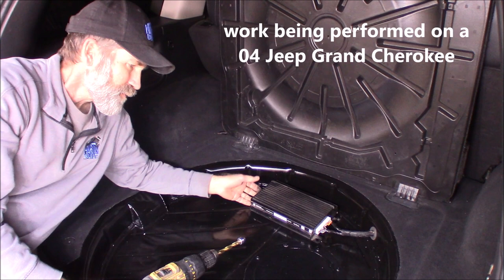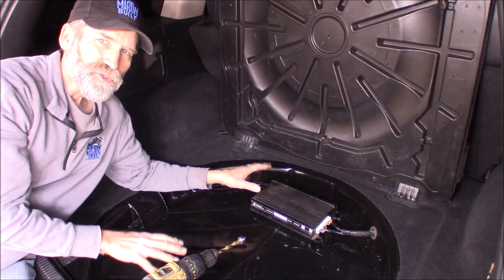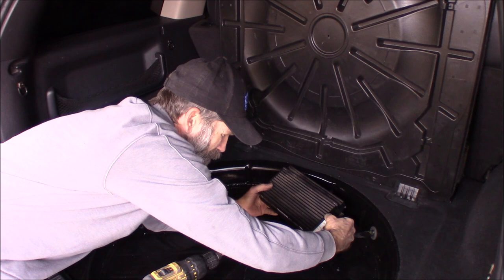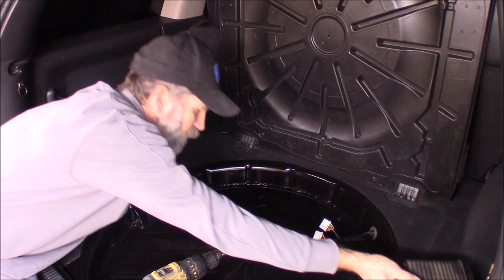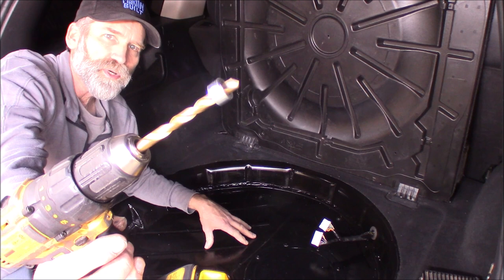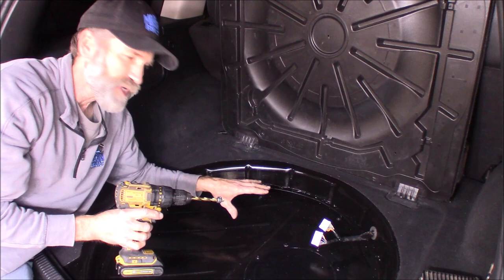Here in the back of my Jeep, what I've already done is a fuel tank tuck — I've raised the fuel tank four inches, so no more spare tire in the back. This just becomes a small trunk area and a great place to mount the amp. Here's the factory amp. I've already got the holes marked — there are three mounting points on this amp. I've also placed a piece of steel underneath between this and the fuel tank, and I'm using a drill bit stop so there's no way I'll make contact with the fuel tank.